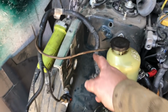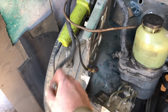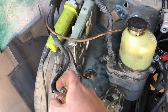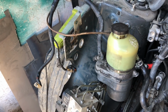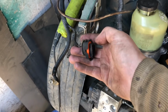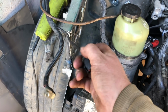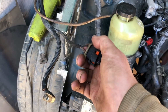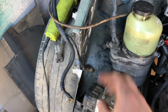So how it normally works is obviously you've got two thick wires, one's an earth, one's a positive. I'm going with the red being positive, brown being earth, because it's Vauxhall, I'm sure that is what they used to do. Anyway, you could all be screaming at me now, going, no, Matthew, wrong way round. But I can't have red. Who would have red as an earth? And then you have three wires on here, smaller wires, which the main one is a trigger wire, which is like a 12 volt, which you can connect up to your ignition, or sometimes it works off the alternator light.